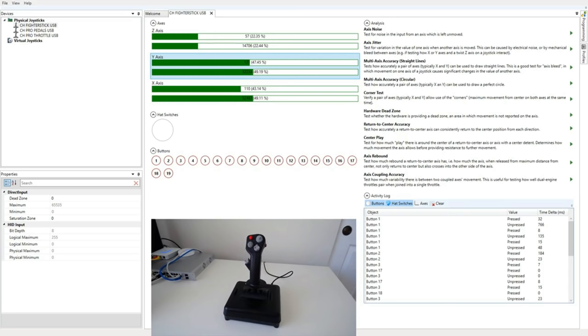So this is really meant to be kind of a private way of communicating which mode you're in that CH Control Manager can use to control what mode it is in software. If you are seeing the CH virtual device that you will see if you use CH Control Manager, those three buttons are gone. So you're not meant to be using them. And one reason that I suggest that you do use CH Control Manager is to get rid of those buttons. Because if you have two buttons activating when you press that, it could be very confusing to some games when you're trying to bind. It may pick the wrong one, like say you're in Star Citizen and you're going to bind this to something, and then it picks up button 17, and you're only going to get that activity every third time you press it.